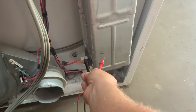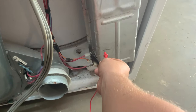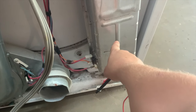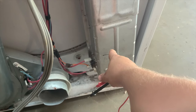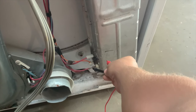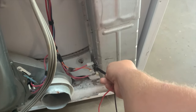Another thing I'm going to test is from the top of the heating element to the frame of the actual heating element. If this beeps — if you have a connection between these two — it means the wire on the heating element just behind here has popped and has fused with the wall. That's one issue that's always hard to find, but this is a quick way to figure it out. Test from here to the frame, and also from here to the frame, as it could be the wire is broken in one spot and fused in another.